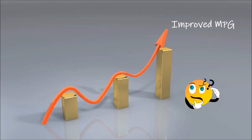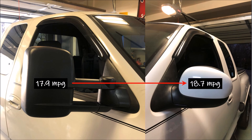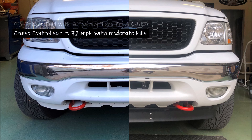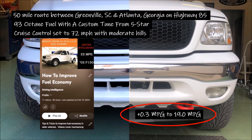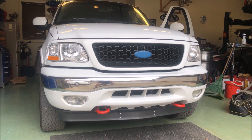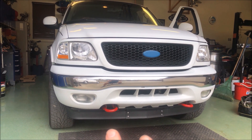Now on to the results. As I demonstrated in my prior video, I improved fuel economy 0.8 miles per gallon by removing the huge tow mirrors and returning to the stock F-150 mirrors. To ensure this is an apples-to-apples comparison, all test parameters for this spoiler test remain the same — speed, fueling station, highway route. The deeper Tahoe spoiler delivered a 0.3 miles per gallon improvement over the shallow stock spoiler. All these fuel economy videos are included in a playlist linked below. The results definitely show there is some benefit to a front spoiler.